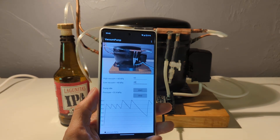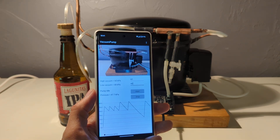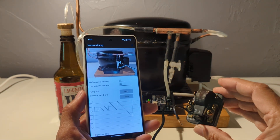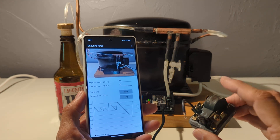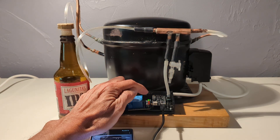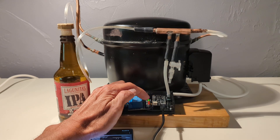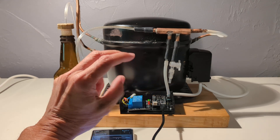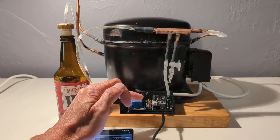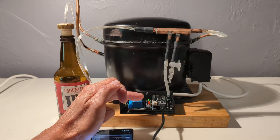You can set the lower and higher thresholds for the vacuum. Inside the fridge, I have removed the thermistor and a relay which was not very reliable because of overheating. So I have a system with two coils — you can see the second LED here. The second LED is a running coil and the first one is a start coil. I have my own logic to apply a very short impulse lasting 0.5 seconds to the start coil.